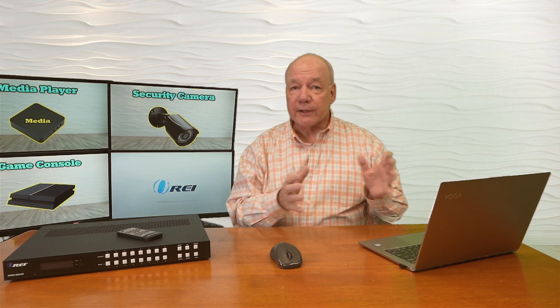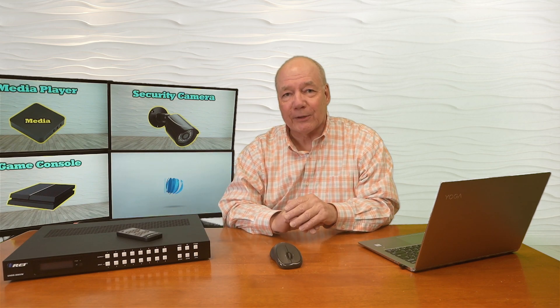Now I'll show you how the video wall function works. A video wall generator essentially takes a single input and spreads it across a grouping of monitors to give you an incredibly large video wall. For this demonstration I've set up four monitors in a 2x2 configuration to display one of the inputs as a larger image. You can change that configuration through the application to organize as many monitors as you'd like, up to eight - you can go with 2x2, six monitors, eight monitors, whatever's best for your particular configuration. Once you've set that up, it's really important that you plug the monitors into the output ports that match up with the configuration so that it organizes correctly when displaying that larger image.